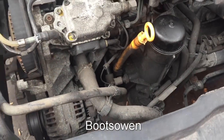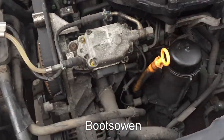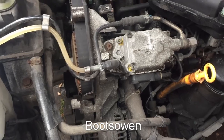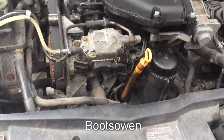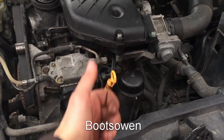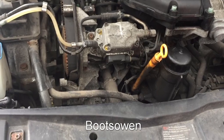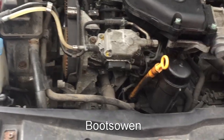That was the auxiliary belt pulley on the crankshaft — in the end it needed a lot of beating. I showed you the tail end of that. I tried it with the air chisel first, that didn't budge it, and a brass hammer is probably better. About six hours total. I also wasted a good half hour because I hadn't put the lower cover on and had to take off the bracket again. I wasn't satisfied the first time I checked the timing — just me being pedantic. I've seen it online — you could do it in three hours. I'd say if I did it again I could do it in two to two and a half hours. Okay, I'm glad it's done. Thanks for watching — any questions or comments leave them below. I'll post some links below to Amazon. See you later.